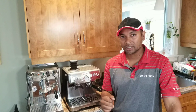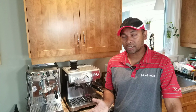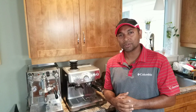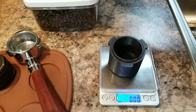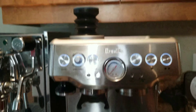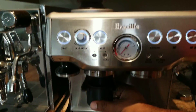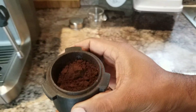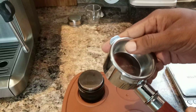To get 9 bar pressure, your grind size should be very fine to really restrict the flow. It is possible to get up to 9 bar. Try some shots — you have full control from zero bar all the way up to 9 bar in pre-infusion only mode. Let me know in the comments how much maximum pressure you achieved and how the espresso tasted. Anything between 6 and 9 bar should taste okay. I'm now going to make a shot and try to get somewhere close to 9 bar.